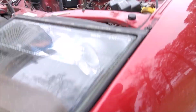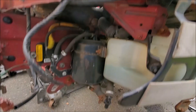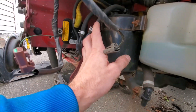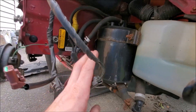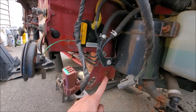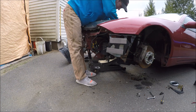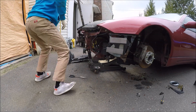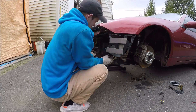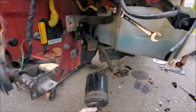I'm gonna make this as simple and dummy-proof as possible for you guys. You're gonna want to disconnect this hose here and run a line from this line to this line — and that's it. We're gonna take this line off, delete the whole entire carbon canister. You don't have to worry about this tree plugging up anything. All you're doing is running a line from here, down under the headlight, through under here, and it goes right to here.